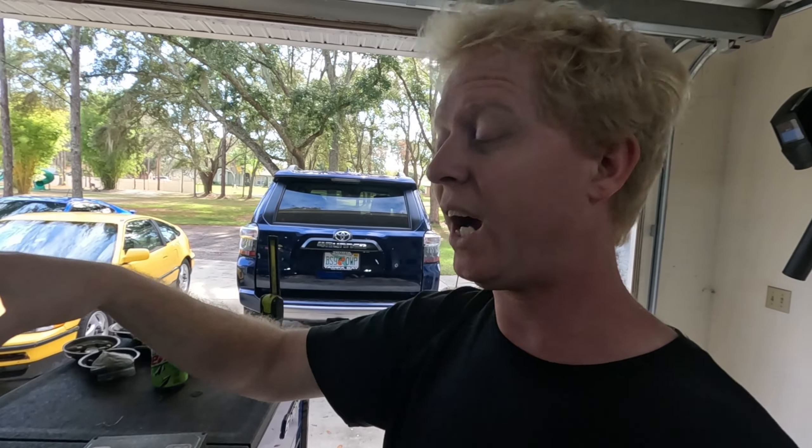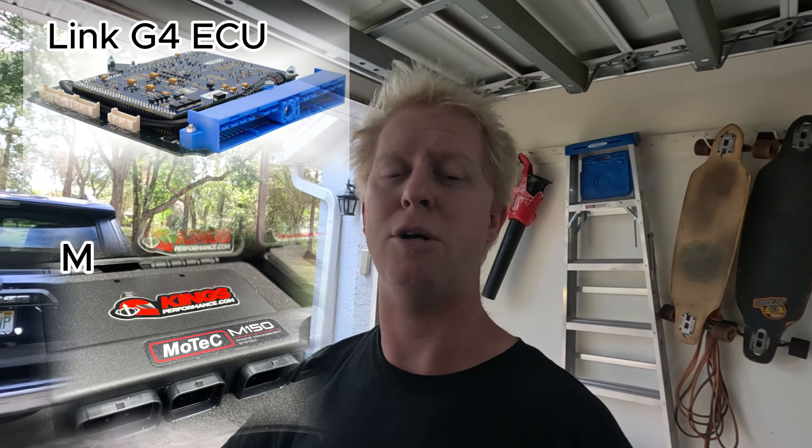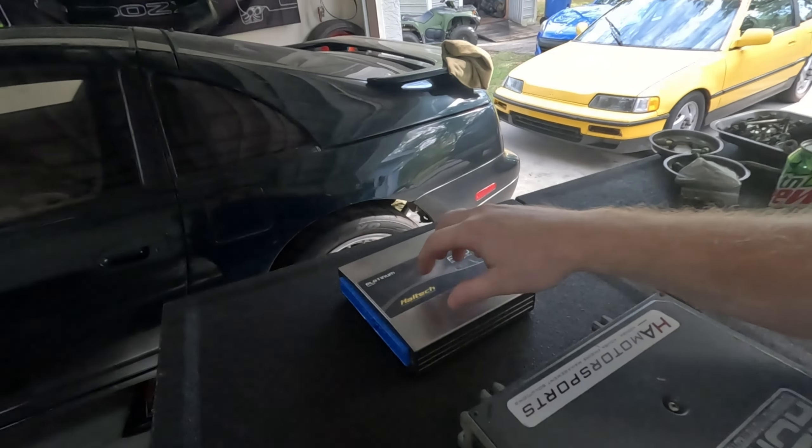Let's focus on the standalone first, because primarily I know a lot of you are here for the 300ZX. We'll dive into the ECU I use and why I have a standalone for my Z, and go over pros and cons of getting one versus other standalone ECUs. I have a Haltech, so I'll be a little biased toward that, but I'll touch on Link ECUs, MoTeC, ECU Masters, and ProEFI. For standalone options we have Haltech, AEM, Link ECU, MoTeC, Megasquirt — those are pretty much the big ones. If you're a domestic guy, you're probably familiar with the Holley Dominator or Terminator series standalones as well.